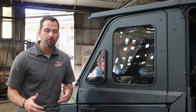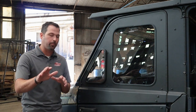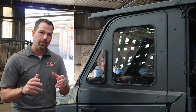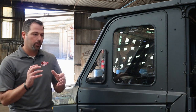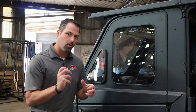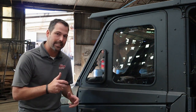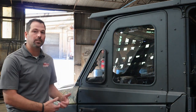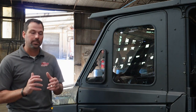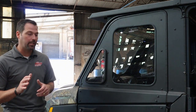When looking at this latch system: this is a dual locking rotary latch. You're going to close that door and it locks once, then close it a little more and it locks twice. You want to make sure you have things adjusted so you're getting that second click. Most of the calls I get on latches are based on only getting one click because it's out of adjustment. Make sure to get that second click to have a nice secure close each and every time.